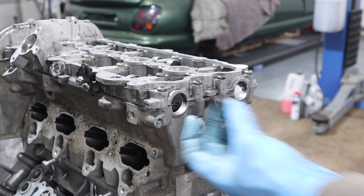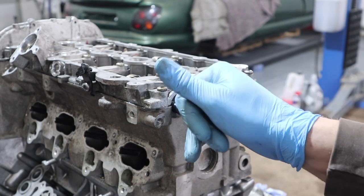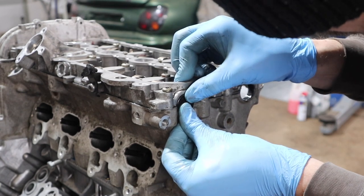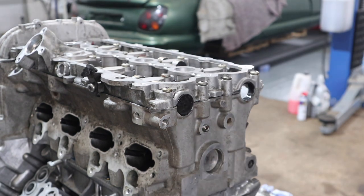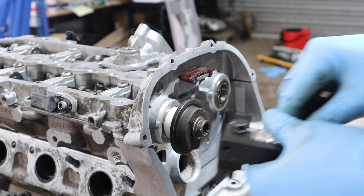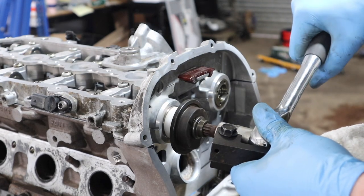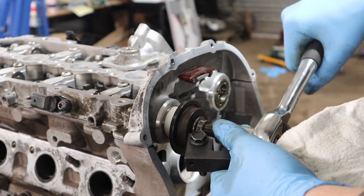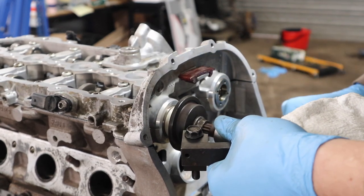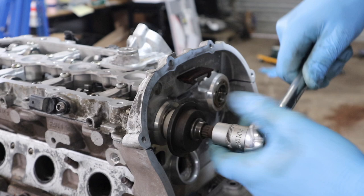I've just got the end cap plastic bungs going into the end of the camshaft - I'm putting some silicone along the inside. I don't have the correct tool to turn the camshaft over without any chains on, so I've put some buffers in. I don't think the valves are going to hit a piston - if I can just turn it over enough... no they do! I need to turn the engine over so I can get the pistons floating and get it into the right position.